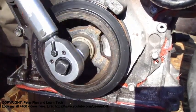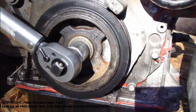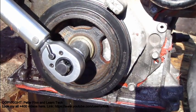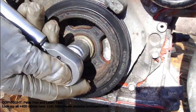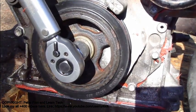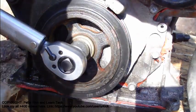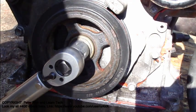This problem situation is that this wheel is moving and I need to do some locking system so that I can lock this. Again, next week I will look at this flywheel. The other way is that if this part is in the engine and you have a transmission, we insert gear one, and then there is this friction. But now when I don't have this transmission, I need to lock this flywheel.